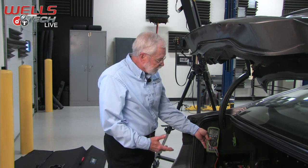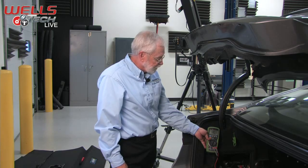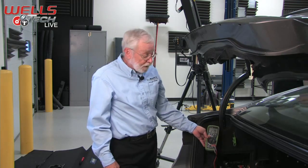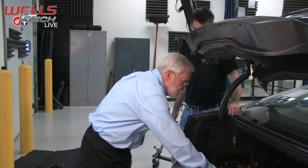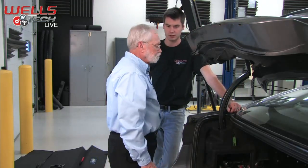And the battery voltage is starting to climb. It's ready to drive. 14.5, 14.6 or so. And it's going to be a little bit lower back here than up front because we've been drawing from the battery, and you can expect that. But somewhere around 14.5, 14.7 is quite normal DC to DC converter output on these batteries. That's pretty much a normal charging system output, really.